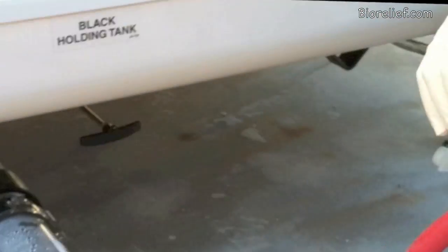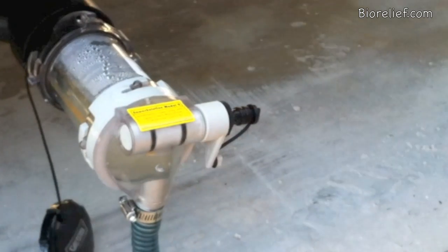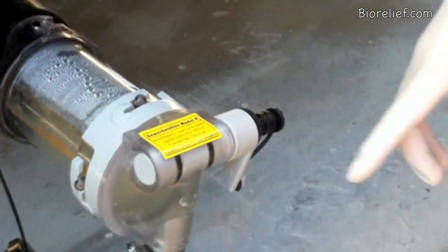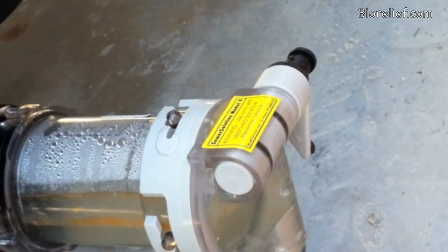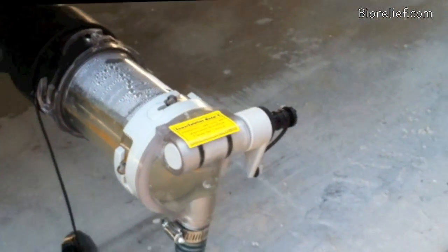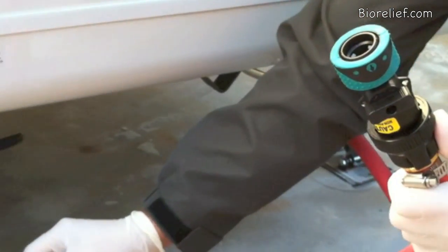Now it comes time that we're going to empty this out for the very first time. A couple of things I want to point out: when you get to the campsite, you can leave your gray water on. This is different than most tools, because with the Sewer Solution you've got the water flowing out of this one-inch pipe, which is good, so you can keep your gray tanks empty. The other reason you want to do that is because the Sewer Solution is self-cleaning, so you don't need that gray water in there to clean out the tank.